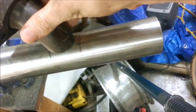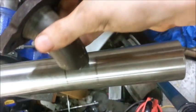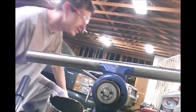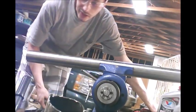I've got a piece of pipe — took the normal exhaust flanges that I cut off, measured it out, going to cut a square to slide in there and weld it in while it's still in the car. Now that it's cooled off some I can put my shirt back on. My son's giving me grief about my glasses — little hater.